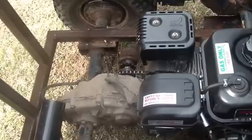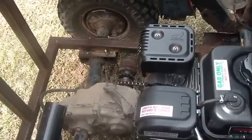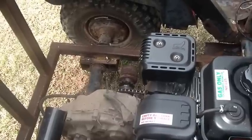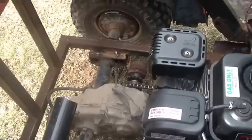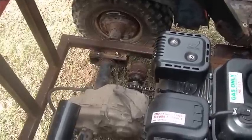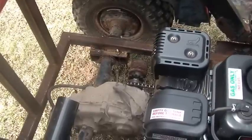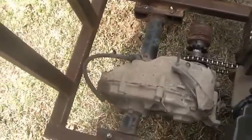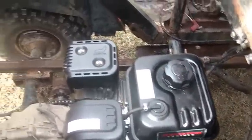Then what I did — if you're familiar with these things — they have an integrated motor and transaxle driven by a torque converter. I pulled all that out and sold it. One of my subscribers in Wisconsin bought it. What I did next is put a golf cart rear end in it and a simple Predator motor.